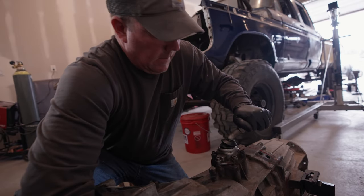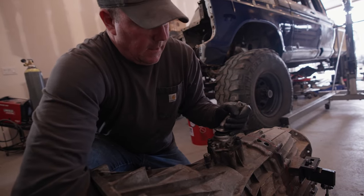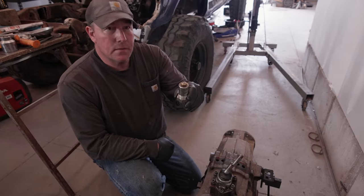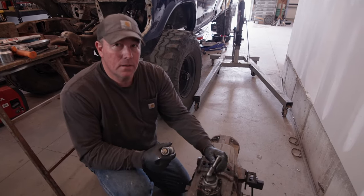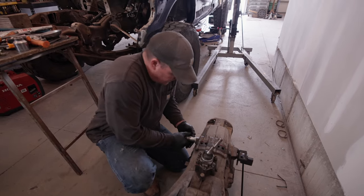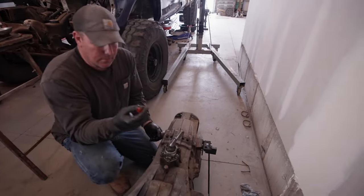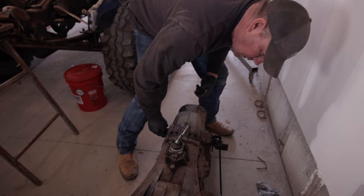That's reverse, that's first, that's fourth - that's a lot of gears. Okay, happy with that. It has gears, it spins over, so hopefully that's good enough. This giant thing here is like a big detent ball - right now there's no resistance in that shifter at all, but there's a thing back here that's got a bunch of detents on it and this ball rides on it and stiffens the shifter up. We'll throw that in and then there's this - I'm going to assume it's a reverse switch sensor. Not sure where it goes, we'll find it eventually.